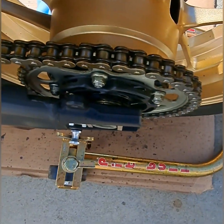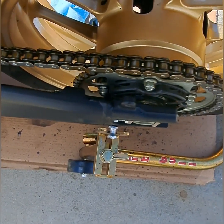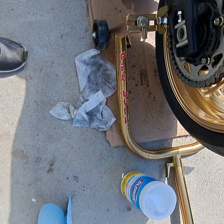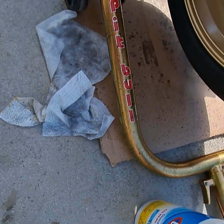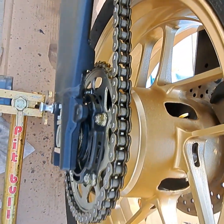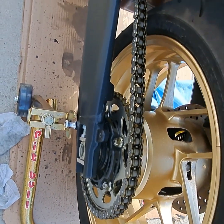The last step is you want to clean your rim real good and check the air pressure on your tires, rear and front — they're both 42 PSI, so between 40 and 42 you should be good. Make sure it's the right pressure. Then put all your guards and stuff back on. There's a lot of grime that gets on your rims from this cleaning job on the chain. I recommend Clorox wipes — they really help you get those rims free of all that black gunk. Then I'm going to get my wax, my microfiber, put some wax on the rims, put everything back together, and I'm good to go.